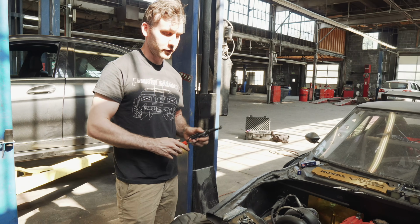But the next thing that I would check over, if you are turbocharged, you definitely wanna make sure you have no boost leaks. You don't wanna be on the dyno worrying about boost leaks. Josh actually just came recently and redid my intercooler piping. It looks pretty much the same, but he actually tightened everything up. Because before I was actually hitting on the inside of here, and now I have a whole lot of range of motion before it even gets close.